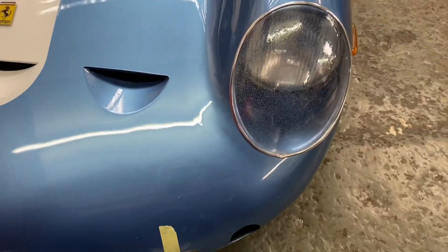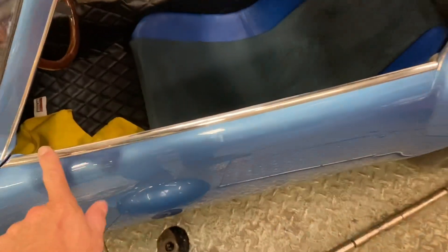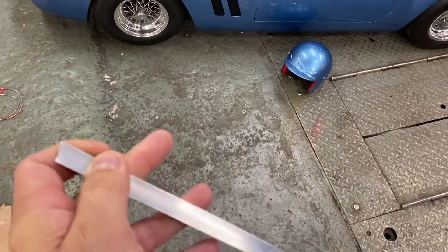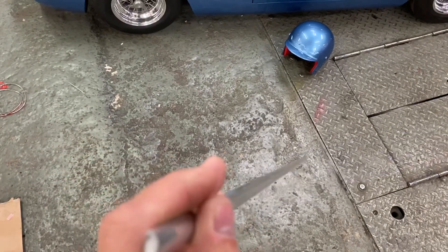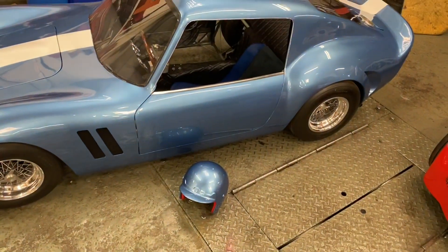This one's about done. I've changed these trims here for aluminium — it's just this half-round, they call it half-round, though it's actually a bit less than that, slightly concave underneath. You should be able to buy this from a metal stockist — it's half-inch wide by three-sixteenths, and it's got quite a nice smooth finish so it's easy to polish to make it look like chrome.